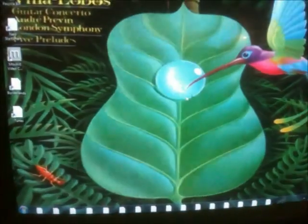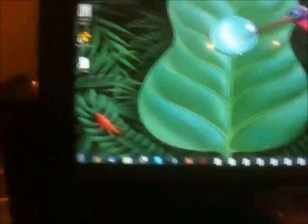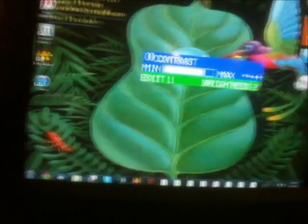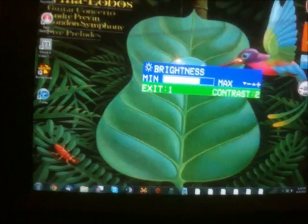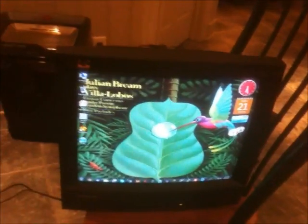As you can see, that monitor has nothing on it yet. Now that monitor starts up and we have my login stuff here. So let's log in. It looks pretty clear on the screen, but in reality it's not that clear — not as clear as I wanted. And the tube hasn't warmed up all the way, so of course you see all this crap down here. It looks a little washed out, so I've had to bring the contrast and stuff up quite a bit. I think that's just because this tube is getting old, though it's under 10 years old. So what we're going to do is adjust the flyback and see what happens.